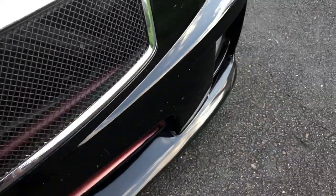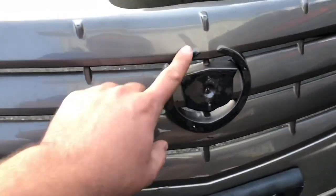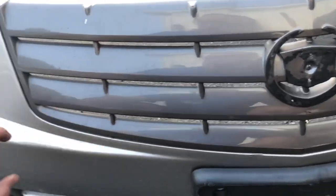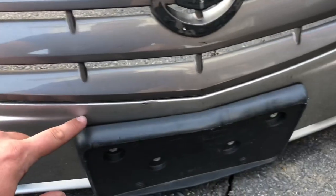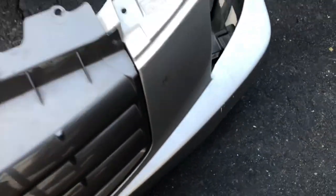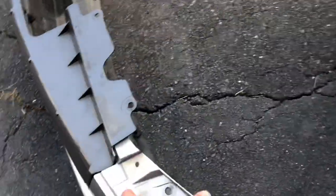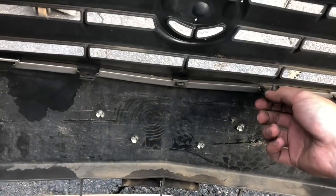That way you'll basically see the bar all around. Of course I'm not gonna cut my bumper, I'm gonna cut this base model bumper, so it has the base model grill which is a little uglier and no emblem. I can always get an emblem, but I think I might just get a replica V grill to put in here if it works. I'm gonna cut along this line to here, come straight across, and then swing back out. That should be rather simple, and then I'll be able to use all the tabs up top to mount it, and down here I should be able to throw a zip tie through here and here to hold it to the bar itself.